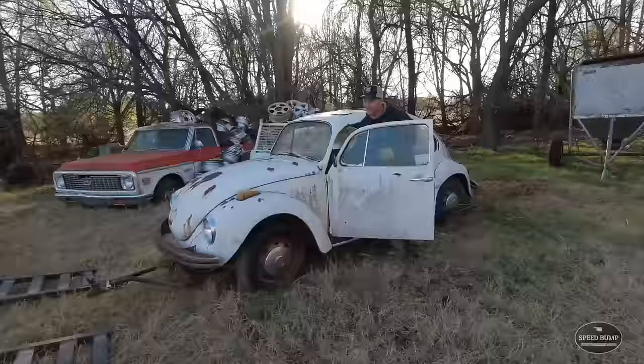Pull this. Okay, the points are definitely dirty. And don't tell mom, but I stole a nail file and we're gonna use it to clean those points. I don't know how well you can see, but I'm just gonna stick the nail file in between these two and sand away.